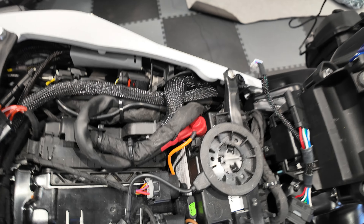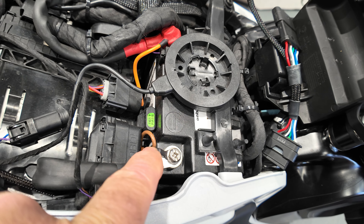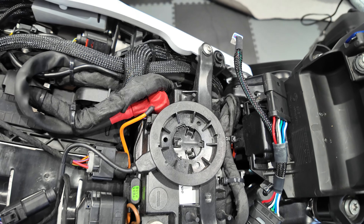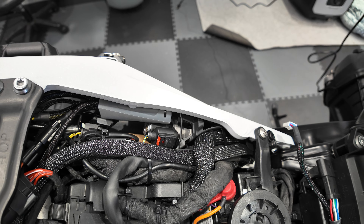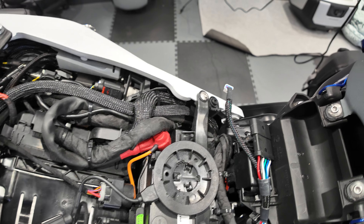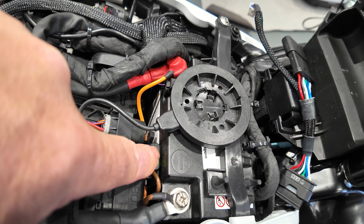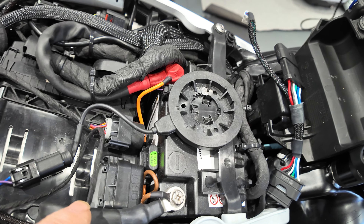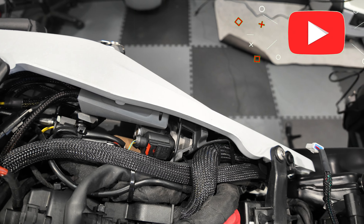The positive and negative connections go to your battery - the brown is the negative and the orange is the positive. These cables route out of the back of the Hex EasyCAN, around underneath the seat brace, and back down to form a nice tidy loop. I've routed them down the back of the battery - the fuse holder is there, everything's neat, and that's the power supply to the Hex EasyCAN.